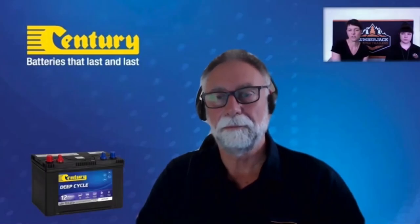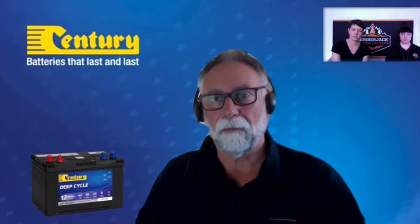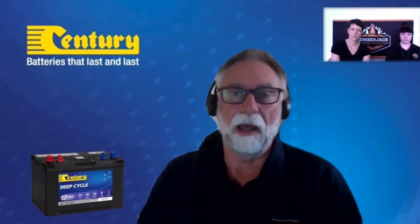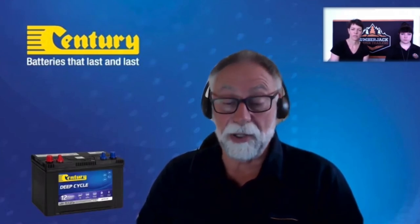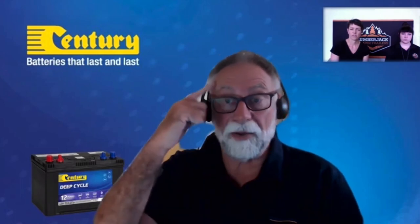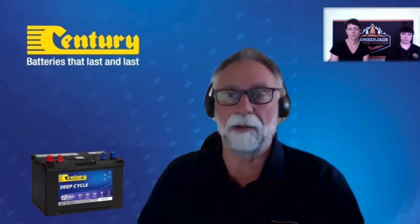For long-term storage of my trailer, what do I need to do to keep those batteries in top condition? The key is keeping them charged and keeping them clean — it should just be part of a maintenance regime. If you want, you could actually take the batteries out of the unit and put them on a bench charger beside you as a mental reminder to check them. Or put a note on your phone calendar every couple of months: 'camper batteries' — then go and check them and pop the charger on overnight if needed.